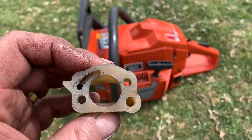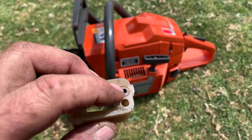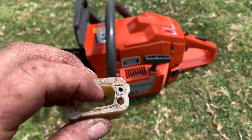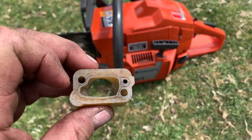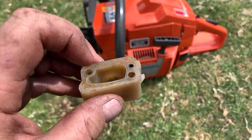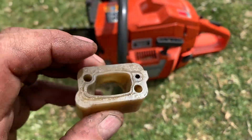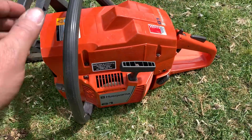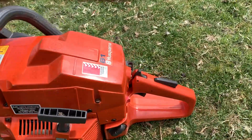What I've actually seen people miss is the intake block. You can use a 61 intake block with it, but the 272 intake block is about a third bigger again. It'll line up to the 272 cylinder, bolt up no problems, but I reckon you're losing quite a bit of performance if you use the 61 one. So it's now got the 272 intake block in it.